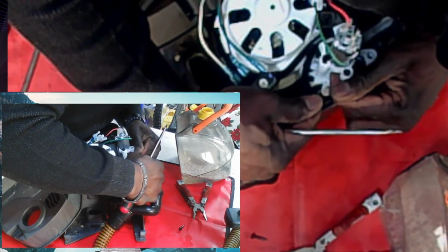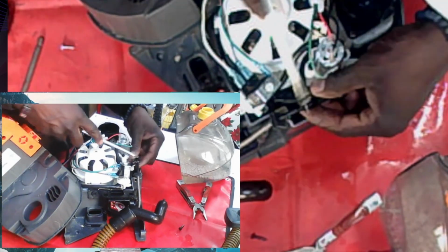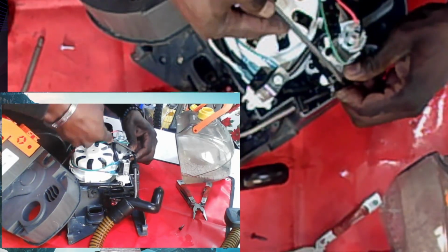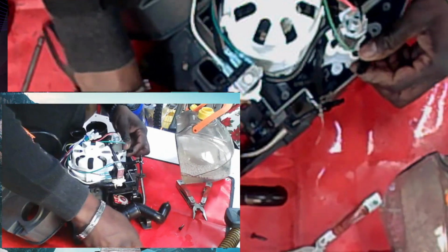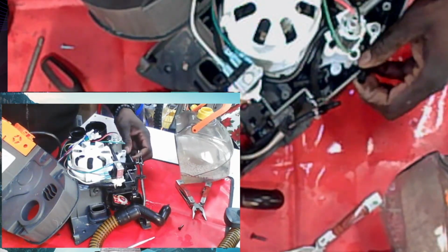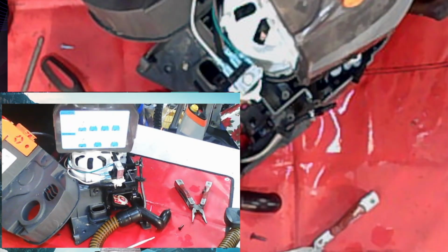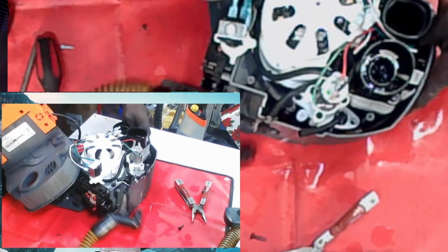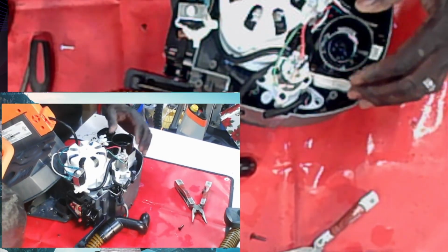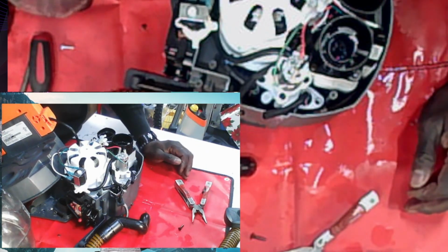I don't get these in a lot. Yes, this one is giving me a tough time. Let's see here. There you go. Let's pull you off, and pull. Great. Let's see if water starts spewing out of here the moment we put the water on. Let's get a feel of this. Yep, I knew somebody's getting water. If somebody's getting water as soon as we put the tank on, that's the hose, which is the same for the Bissell Revolution.